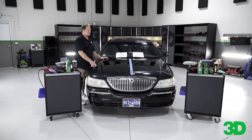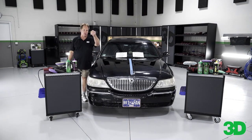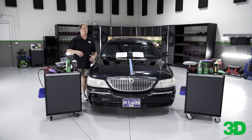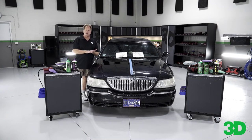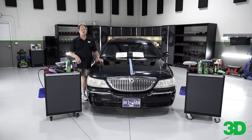Saturday, we move to something completely different — the 3D dry sanding system. I always bring in muscle cars because that's the kind of car that actually gets a custom paint job. Most people shouldn't be out there sanding factory paint because it's thinner than a Post-it note. The cars that get sanded are custom cars with custom paint jobs where the painter puts more paint on. So on Saturday I bring in a couple of real muscle cars with fresh paint jobs. We learn how to use the 3D dry sanding system, then switch to rotary polishers so everybody gets a lot of time learning how to use a rotary to pull out 100% of sanding marks, then go back to orbital polishers to finish out swirl-free, and then we put ceramic coatings on those two cars. By the time Saturday is over, you've buffed out nine cars and learned multiple techniques, including glass polishing, engine detailing, headlight correction — pretty much everything on the outside of the car.